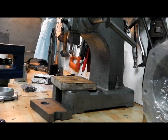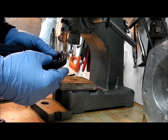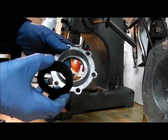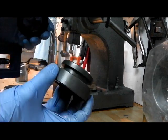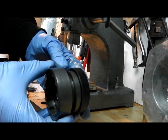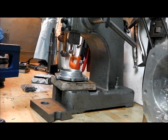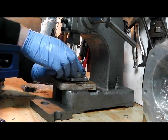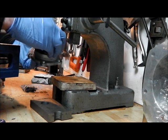While the housing is cooling down I'm just going to fit the seal for the front output shaft. This seal is actually the same part number FRC 1780 as used in the rear output, so you can't mix them up. And it goes in this nice little aluminium housing. To fit this you could actually use the output shaft assembly as a press tool - it's a nice diameter to suit pressing in the seal. I'm actually going to use a large socket just because I've got one. You could probably do this bit in a vice if you really needed to. I've just smeared the inside of the housing with grease - I used to use sealant on these things at one time but it generally is unnecessary.